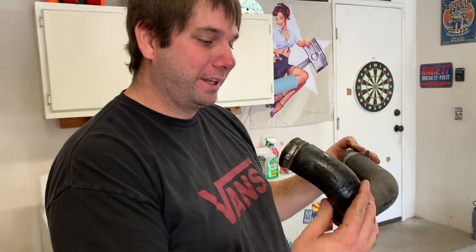So we're going to throw some new hoses on this thing. I've replaced heater hoses before but not the radiator hoses — we're doing it this time. We went over to NAPA to get those hoses. When we came back out to the Cobra, the alarm just started going off out of nowhere. When I bought it, the previous owner said sometimes if you mess with the electric door locks the alarm will go off. A few weeks ago we played with the locks and it didn't go off, so I started using them — and apparently that's why. We had to go back into the parts store and buy a wrench to disconnect the battery just to start the car to come home.